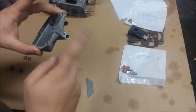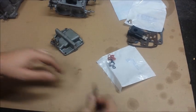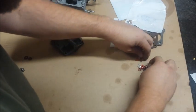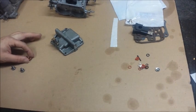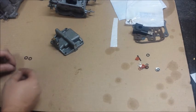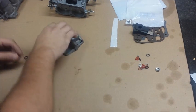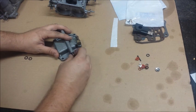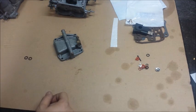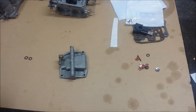Alright, screws are clean. You can then blow through here with compressed air — make sure everything's clean and dry. Alright, I aired that out. Now we can open up our little bag of spare parts, find our two washers for the float screw. Looks like it's gonna be the bigger ones. Reinstall these onto our float bowl. Alright, float's done.